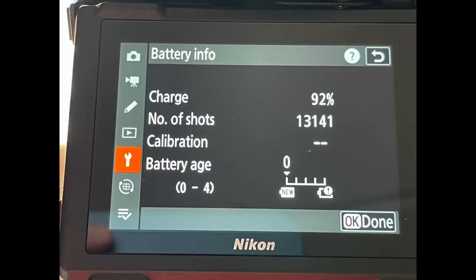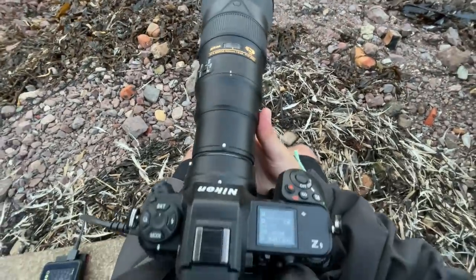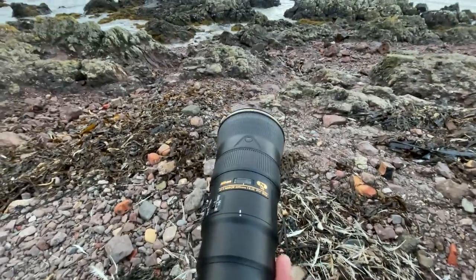There are so many variables with stills photography battery life. Realistically I'd expect the minimum to be around 1,000 to 2,000 shots even with everything turned on — Wi-Fi transfer and all that. I would also expect the Z9 to give me better battery life than a D6 or D5 for a couple of reasons: the battery capacity is bigger, and because the camera doesn't have to drive a mirror motor or shutter motor every time you take a picture. Yes, it's driving an electronic viewfinder and the sensor constantly, but not those mechanical motors — so I'd expect to get very close to, or even better than, the battery life I had from my D5 and D6.